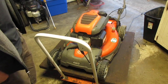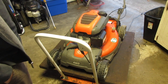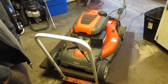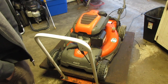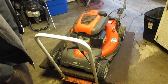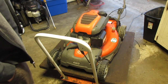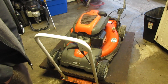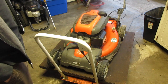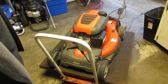So if you have a hard starting Honda with the auto choke, definitely take a look and see if you have one of these. If you do, buy that part number. I'm going to have a link in the description below for it. And just replace it and you should be good to go. Like I said, they get stuck open and closed, so if it's open, it'll run with choke on. If it's closed, you just won't be able to start without starting fluid or like 30 pulls. So keep an eye out on that.